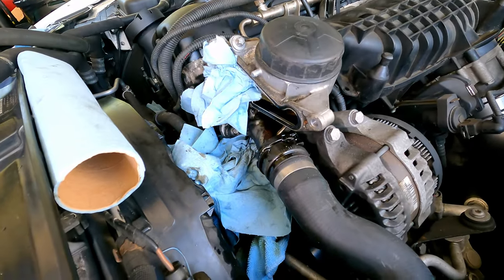Alright guys, if you're in the same boat as us, make sure to cover the surrounding area well with something like a microfiber towel. Also don't forget to wear eye protection. What you need to do here is slice off the head of the bolt, but make sure to cut into the bottom of the circular plate right beneath the head. This will take multiple attempts and a lot of patience, so don't rush and risk any injuries. This is what you want — see how the round plate has been completely cut and removed, and all you're left with is the shank. Get it to this state and you can remove the oil filter housing.